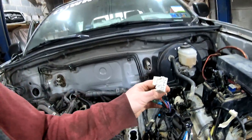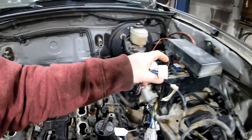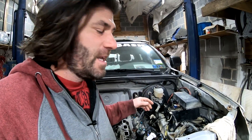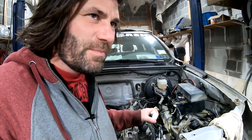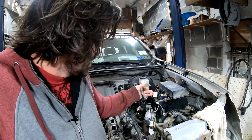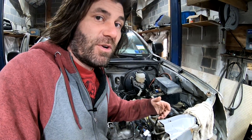Which should be pretty easy because there's a plug in there that ran to the four-wheel drive computer for the Tacoma, so I just got to splice into some of those wires and connect them to this plug. Should be pretty simple. I'd say I got the bulk of the wiring figured out. However, there's these two plugs right here - these wires are attached to the engine harness and they ran into the Tundra fuse box, and they do not plug right into the Tacoma's fuse box. The Tacoma did have a couple plugs running in there too, so I'm thinking most of these wires are probably going to transfer over. I'll just have to cut the plugs off the Tacoma harness and put those plugs on here instead. I'm still having some trouble figuring out all these wires - I got about half of them figured out. It seems the important ones are power - injectors get power from here. This has been taking a lot of time.